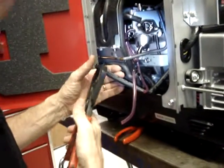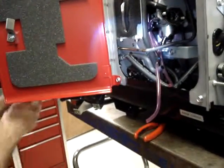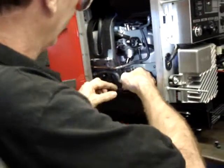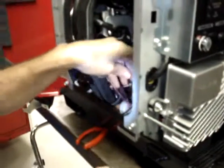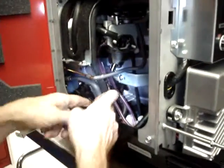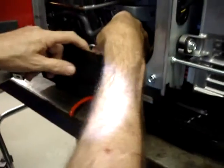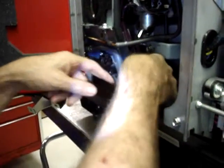And again, that's because I trimmed all my hose sections slightly longer than what it indicates on the paperwork that I send with all the kits. And just because this one seems to be going dead on with all the measurements that I've got listed, I would still encourage you to cut the fuel line slightly longer than I've indicated, because it's very simple to trim them shorter once you get it in place. And you're not going to be able to stretch them and make them longer.